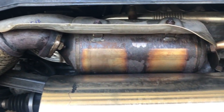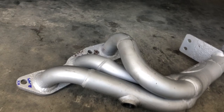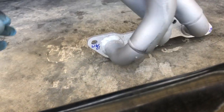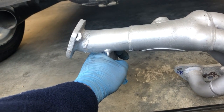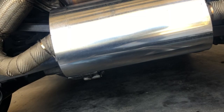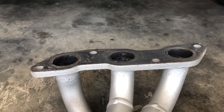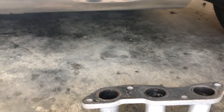As you can see, there's the catalytic converter right there and the Solo Performance exhaust is right here. Now, in order to install the header — this kind of goes like this — you can see that mating surface there to my left of my hand next to the catalytic converter, so that's kind of how that mounts. It's got four bolts that hold that in, and there is a gasket there. You may be able to reuse the original OEM gasket.